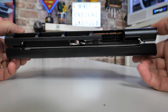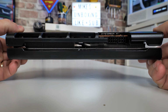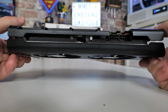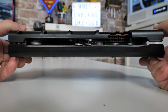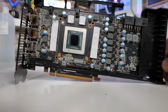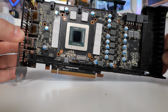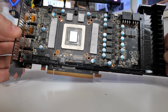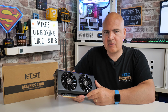Taking a look inside, like we said, 4 heat pipes in there and a nice big heat sink, which does a great job. I've actually repasted this one, with new thermal pads, all that kind of stuff, so no issues there. I wasn't sure what thermal paste they used, potentially because it's come from a wholesaler that has been refurbishing them. You never know quite what paste they've used, so I've put some Arctic MX4 paste on there just to make sure that the paste is a pretty decent one, at least whilst I'm testing it. And speaking of testing, let's take a look at some of the benchmarks.